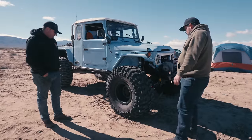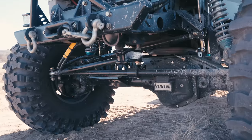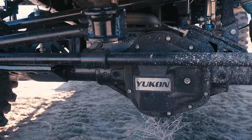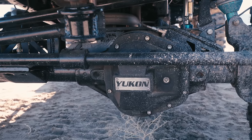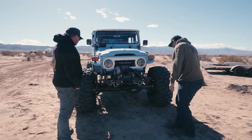Starting from the front back, I noticed you have a Super Duty axle. Everybody's building from Super Duty. Right? It's an '08 Super Duty. I did 1550 chrome-moly shafts in it. And are those just the Spicer ones that are cheap, like $399 for a pair of shafts? Yep. Okay. And I threw the ARB in it, and it has 5.38 gears. And I built the entire axle, trussed it, everything.